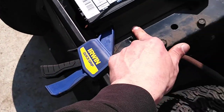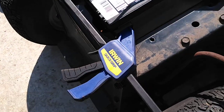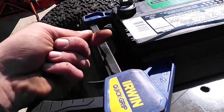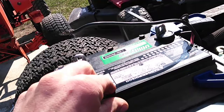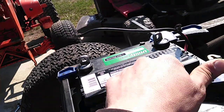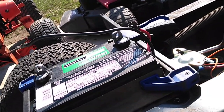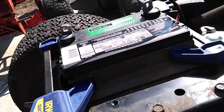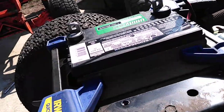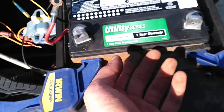And then I got myself some angle iron. What this angle is going to do, instead of making a plate to hold the battery up, there's a lip on these batteries that you can use, and that's going to hold this battery up. I got it clamped in right now so I can sheet metal screw this in, and this will never come off again. When you want to take the battery out, just disconnect it and pull it out. The reason you have to put this angle under here is because otherwise you'll hit the pulley on the bottom — you don't want to hit that drive pulley down there. That's why I came up with the idea of just putting angle under the tab.